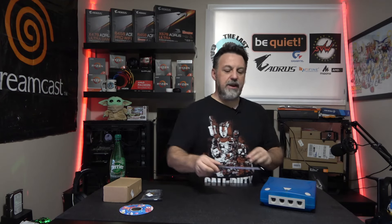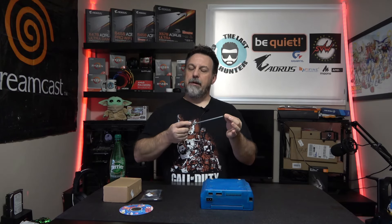One thing you will need is a good Phillips screwdriver — something with a bit of length on the shaft so that you can actually go down in the holes, which can be pretty deep on the console in certain places. This is very necessary to have a decent screwdriver. I felt a smaller bit was actually slipping on the screws, and one thing you don't want to do is damage your original screws.